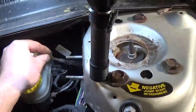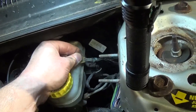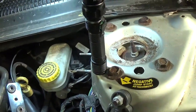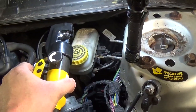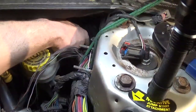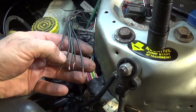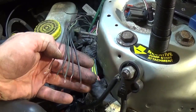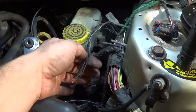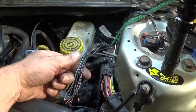I was able to pull the harness up to expose these wires. I'm just gonna repair all this. I'm afraid it's gonna cause future problems because everything looks rusted. I'm gonna use this connector here, this eyelet, and I'm gonna use this tool to crimp it. I'm not gonna be able to put everything in one eyelet because I have to trim all of these — since they're black, the corrosion got a little bit deeper in. I'm gonna trim them until I get to the good wires. I may even find a completely new ground point, and that's not a big deal, but it's not an easy thing to do. At least I was able to bring all this a little closer so I can work on it.